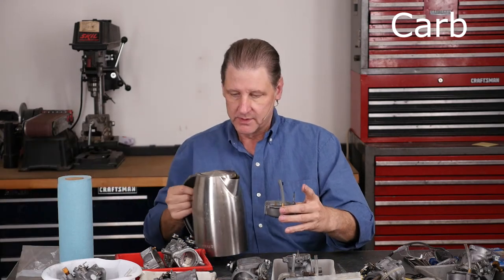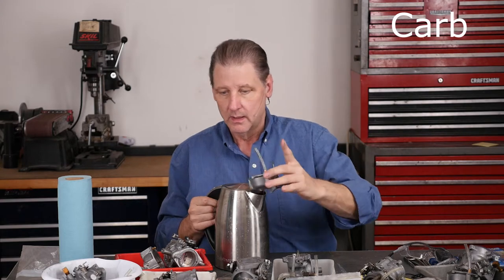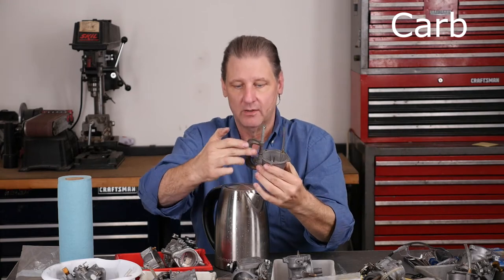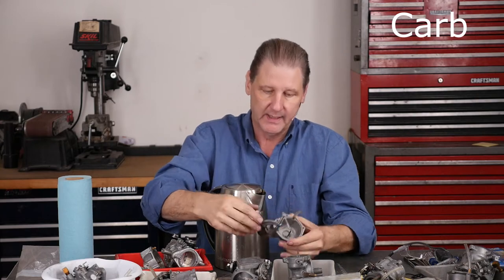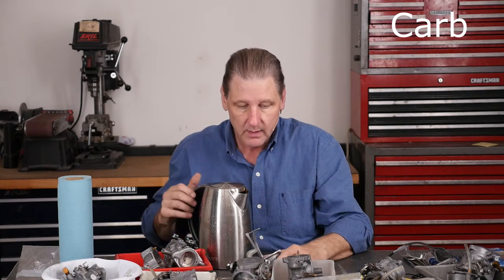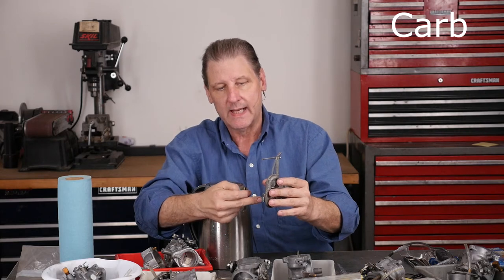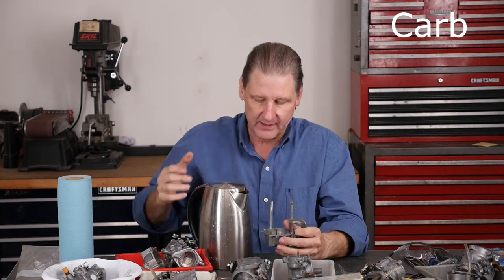The level in this brass tube is only going to go down as low as the gas level in the bowl, maybe a half inch tops. When you squirt it, it's just a restriction they put in there — they're not trying to make a valve. There's no spring; you can hear it just rattles around in there. Now we're not to the clever part yet, where some engineer did a genius cost reduction — this one has the bleed hole too, but the check valve has been taken out of the cap entirely.